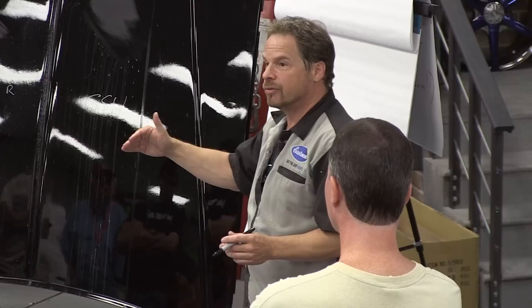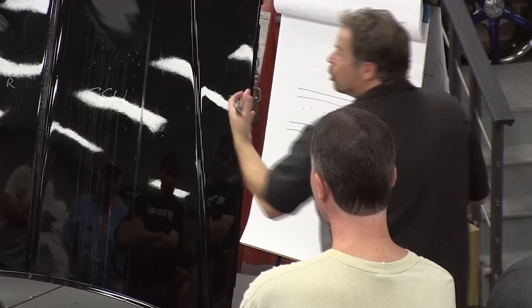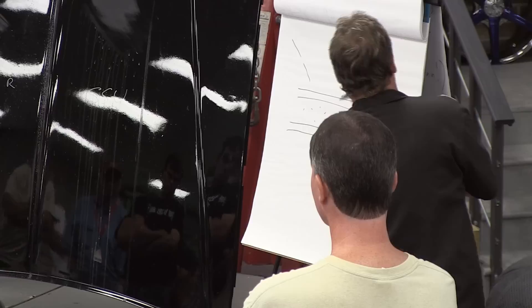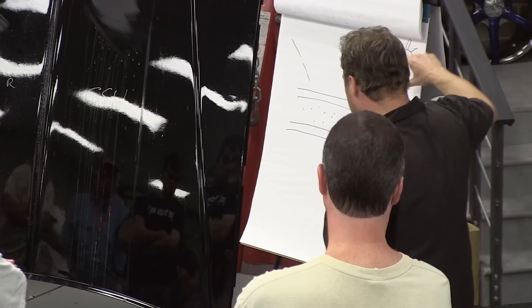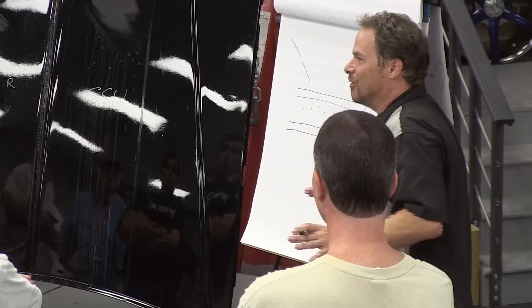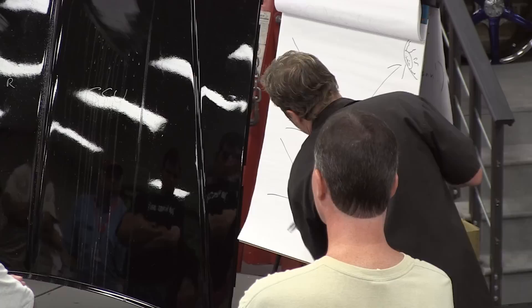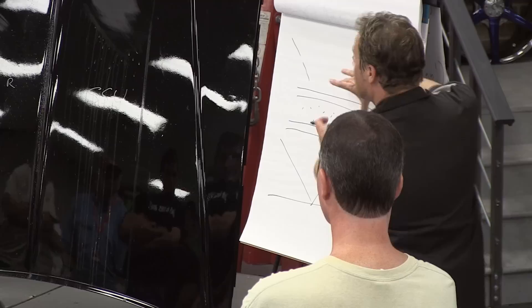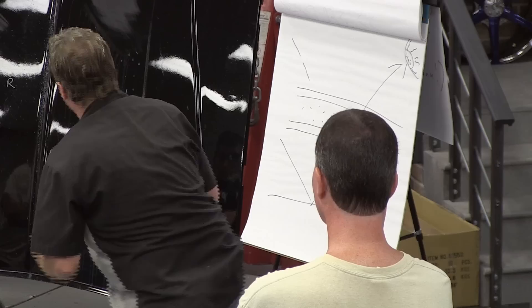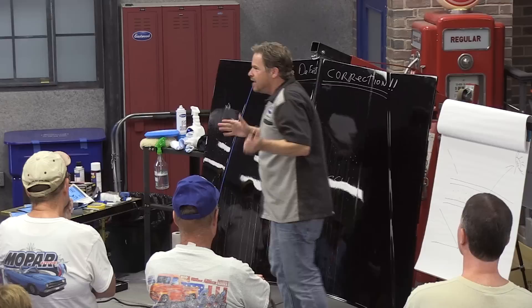Here's your substrate — there's our silver ground coat, our translucent mid-coat, then clear coat. Your sunlight refraction is like a basketball in a room — slam it down, the light comes in, it bounces around, comes back up, and hits our eyes. It's the way the light bounces around in the panel and hits our eyes. If it's soft and it looks like Bermuda bay on your cruise, that makes us feel good — that's why we like beautiful candy jobs. Reflection is purely the light bouncing off the top surface. We see a shine but not the depth. The depth comes from refraction — that's the distinctly different look between a clear coat base-clear system and a single-stage urethane.